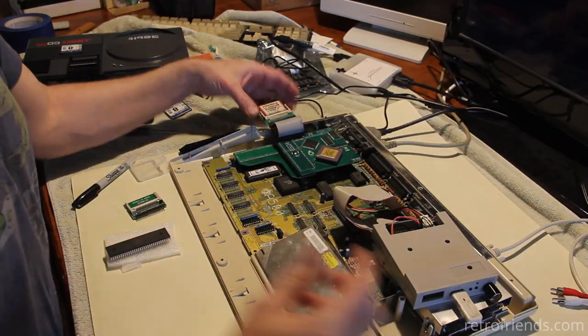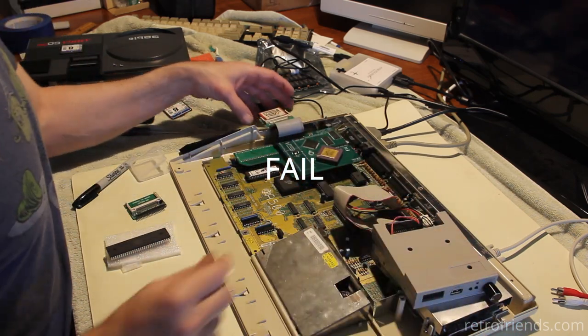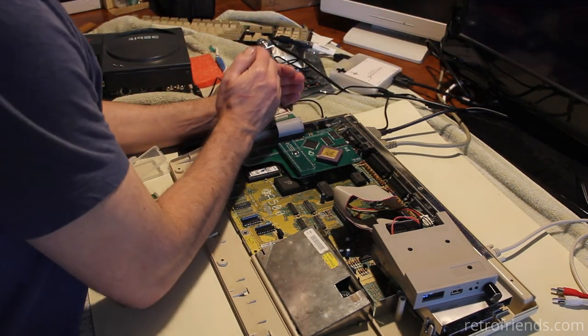When it's reversed and the light is dim, the computer hangs for several seconds and then begins to boot off the floppy — you can actually see the activity on the dim light of the floppy. One thing I need to do is disconnect the floppy, right? Forgot to do that. That would keep it from booting off the hard drive because floppy is given priority.